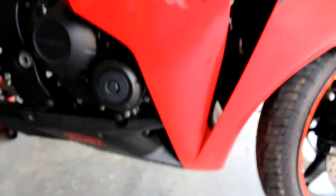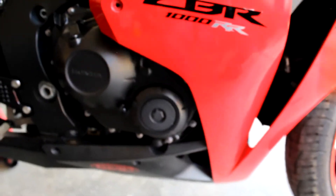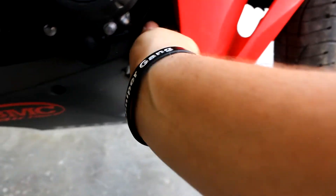There are two push pins on the outside. There's one right here — I don't know if you can see it in the video. The other one is right under here. You would need your Phillips head to take it out. So after taking the bolt and the push pin, this part should come out pretty easy. All you have to do is do that right there at the bottom, and the whole thing should come out loose.